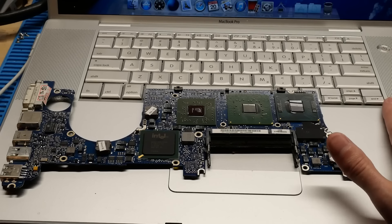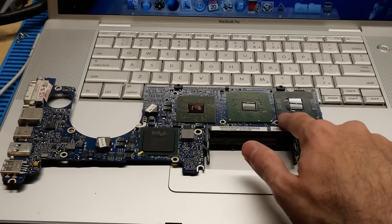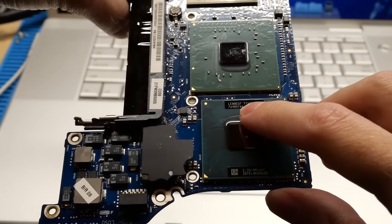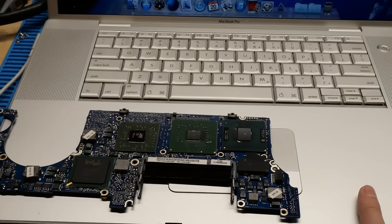So I'm going to get this machine taken apart. This donor board I have already had in the dehydrator for about 24 hours now, so this one's all good to heat. But the one in the MacBook Pro I haven't taken out yet. So I'm going to go ahead and get this MacBook taken apart, get the board in the dehydrator, and then after that we need to begin the process of removing the original 2.33 GHz Core 2 Duo T7600 from the donor board to prepare it to be re-balled and soldered onto this board.